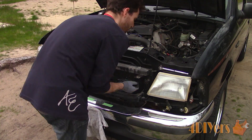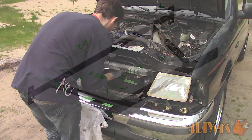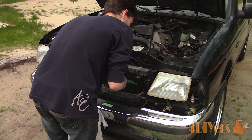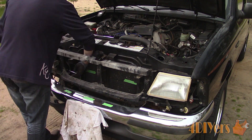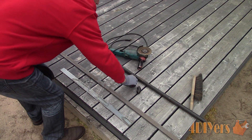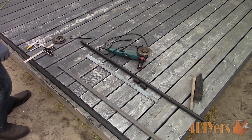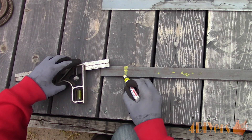Unfortunately further disassembly is required. The plastic frame where the lights and grill are fastened to will need to be unbolted but not completely removed to drill the holes for the fasteners. My rough layout is larger than my finalized design and instead of using T fastening points I stuck with L-shape fastening points instead. For the material it's good to order a little more than you actually need. I went to a local metal supplier and got: schedule 40 one-inch diameter pipe, one-inch 90-degree bends, one and a quarter inch by quarter inch flat bar, and one and a half inch by three-sixteenths flat bar. Purchasing from a metal supplier or machine shop will most likely be much cheaper than a big box or hardware store.